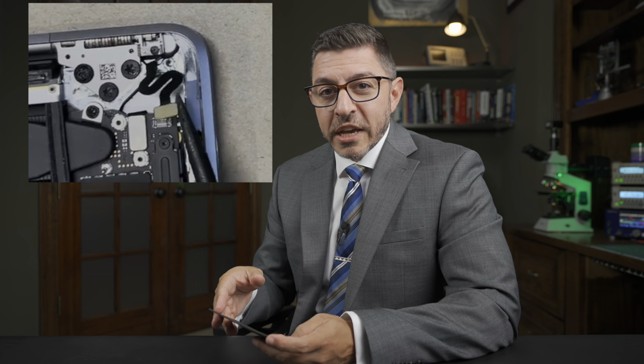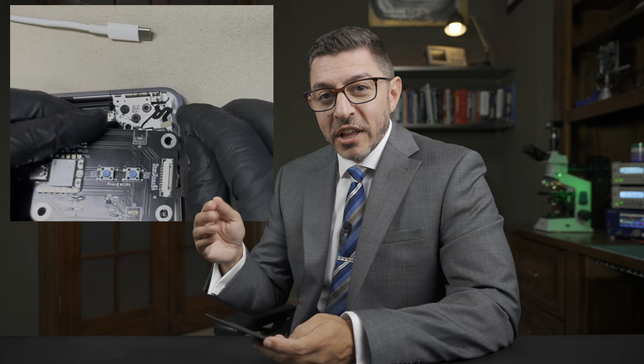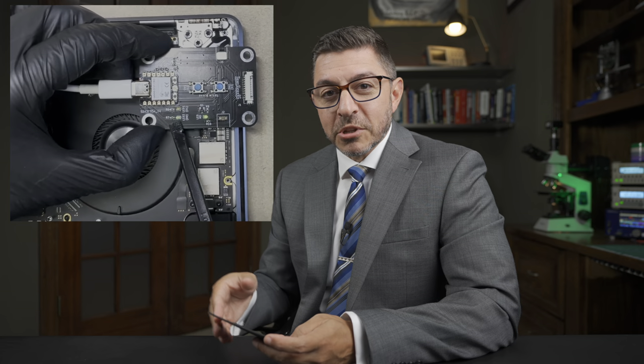Let's chat about reverse engineering to repair. A German company called Notebook Nerds made a tool to repair Apple MacBook computers. Apparently on these Macs, there's a sensor that detects when the screen is closed, and that sensor fails sometimes due to water damage or whatever. Until recently, it was impossible for any repair groups to actually replace this part because you had to have special access to program it. This Hall Effect sensor has to actually be calibrated, and only Apple could do that. Well, they made a device called a Nerd Tool 1 that you plug the sensor into, press a couple buttons, it calibrates it and loads those settings in. They had to reverse engineer how to talk to this sensor — it's not published yet — but they sell this device so repair shops can repair Apple computers.